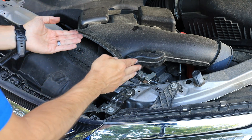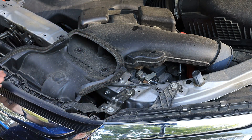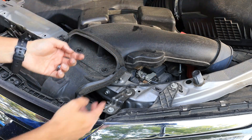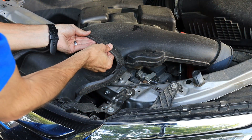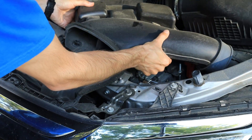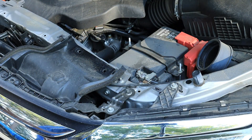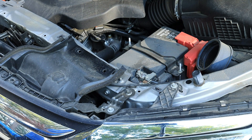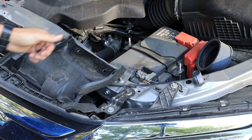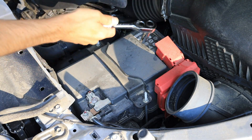Your air box is right here — this essentially is your cold air intake. The air comes from the grill, goes through here, down into your air box. Right here is a connector — you're going to want to pull this straight out. Try not to angle your pull a whole lot. See, that came right out, nice and easy. Once you get the air box taken care of, the next thing you'll see is actually your battery. I'm going to reposition the camera and we'll go from there for the rest of this install.